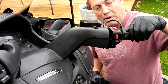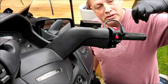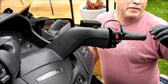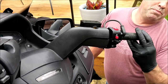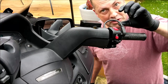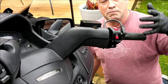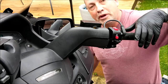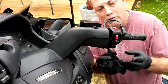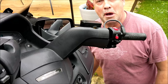The heated grip itself, the rubber part, sits on a sleeve, which then sits between the rubber and the metal handlebars, and that's the part that pivots. They have super glued the handlebar rubber to the sleeve, and I'm guessing they just dunked it in a bowl of super glue and then put it on the handlebar, and the excess built up and oozed out and gone down the inner side of the shell. Whoever put it on was a Muppet.